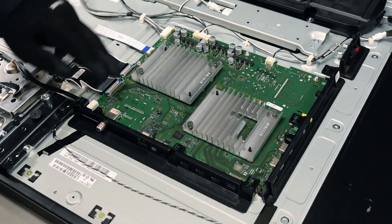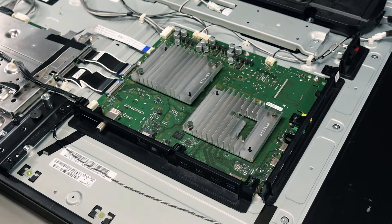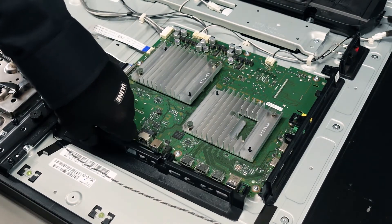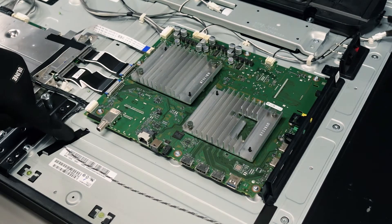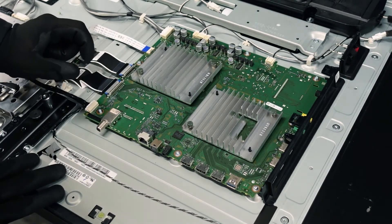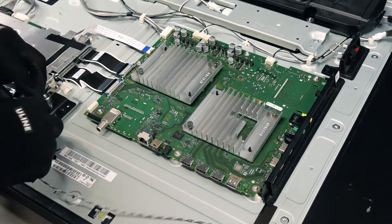We're going to move on to the main board. We went ahead and reconnected these cables just so we could show you how to properly remove them, in case you need to remove this instead of the T-con we just worked on. For this one, take a look at this plastic bracket — put your thumb on that coax and shimmy that whole frame right off. Now we have more room to work with. We've got this clip, but it's also held down by tape — get underneath that tape, peel it straight back gently, then pinch the clip on the sides and pull it right out. This one's going to be a little more snug, so have some patience and use two hands. There we go.